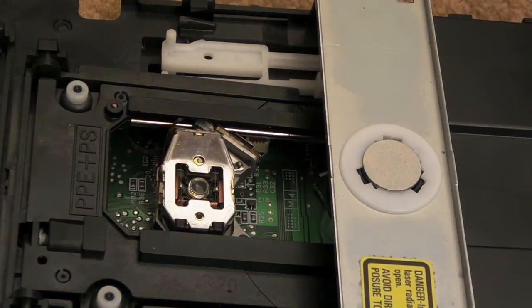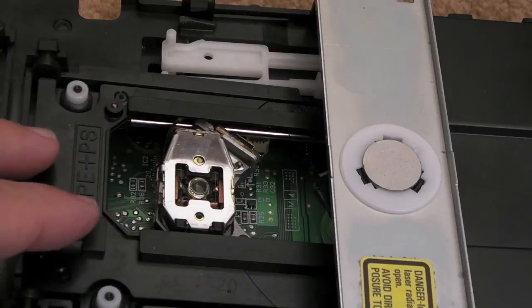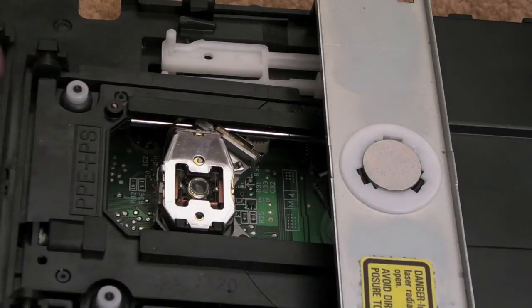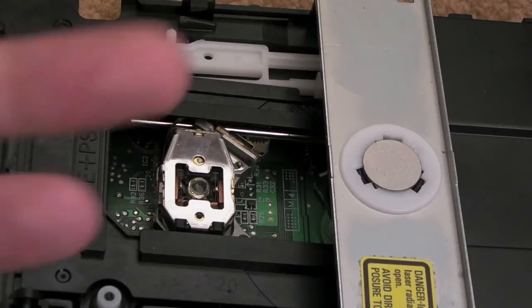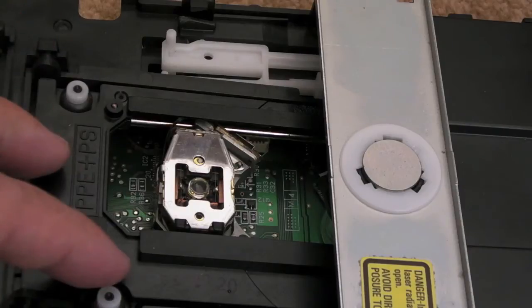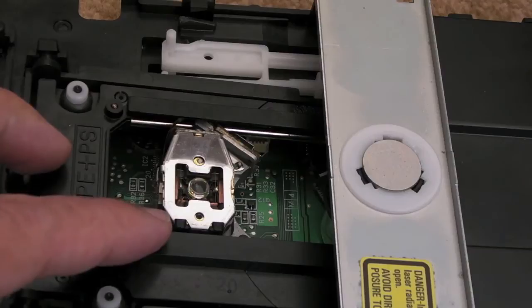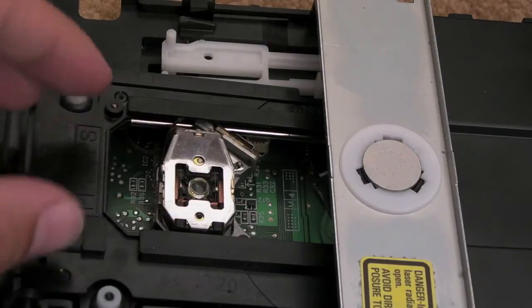They're very fiddly to work on because there are a lot of unknowns. You don't know what's been done to them before. And unless you've got a lot of experience and exposure, and maybe the service manual, you've got no chance of being able to determine whether the laser is there or not, whether it's focusing correctly. A lot of these things also have adjustments to tilt the assembly one way or the other.